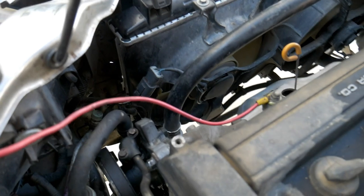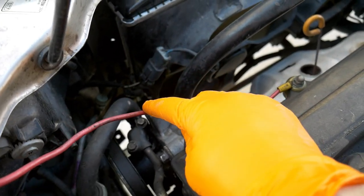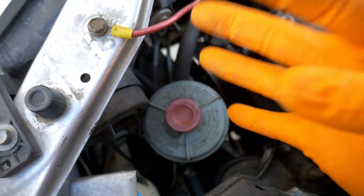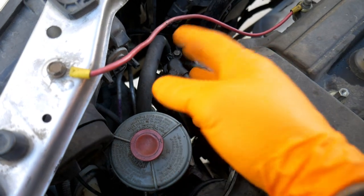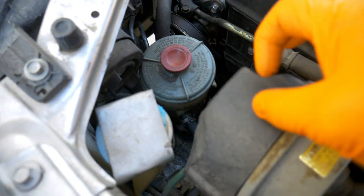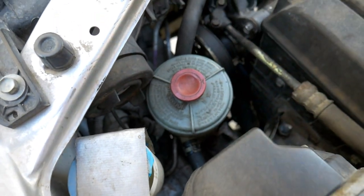To help make the process a little easier, I'm going to remove the condenser fan — there are just two 10mm bolts and the wiring harness for the fan and the AC compressor. The receiver dryer is underneath the power steering reservoir, sandwiched between the windshield washer reservoir. I may or may not need to remove the bumper. I'm going to attempt to get the power steering components removed — it's just two 12mm bolts. I may also disconnect some hoses to get to the receiver dryer.